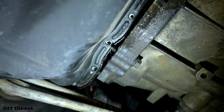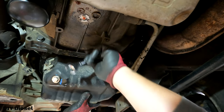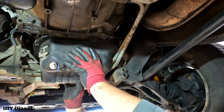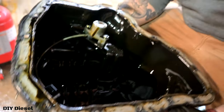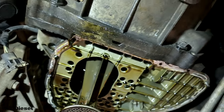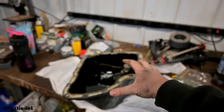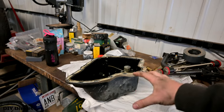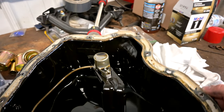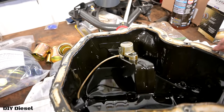What I'm showing you right now is we're going to back this bolt out a little bit — it's going to be a 15 millimeter, just on the bottom of the transmission. Back it out just a little bit so you can get that oil pan pulled out. Here's the factory pan — we've got it out. You can see there's about a half quart of oil left in, and you don't want that — it's a lot of dirt and debris. Watch the unboxing video, link below, so you can see the differences.